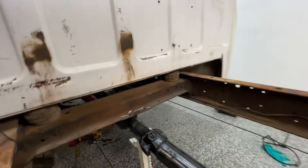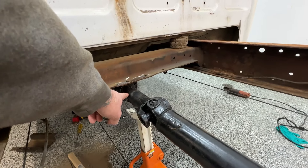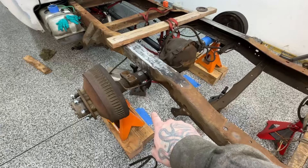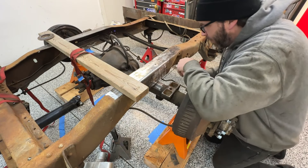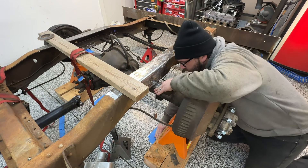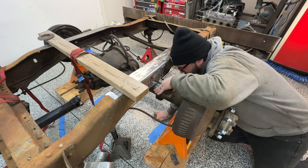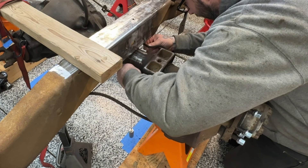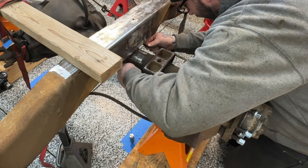What I did — I don't want to get ahead of myself too much — is I had to move my carrier bearing up because my pinion angle was all messed up. Nothing's set in place yet. I just took it off to get my measurements, heights, and whatnot figured out. So let's go ahead and make sure that this thing is straight and true and get those held in place. Remember, everything is based off this. You need to make sure that this is spot on. If it's not spot on, then you're not welding it in place. Do not do anything until you've got this perfectly straight and true.